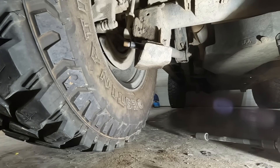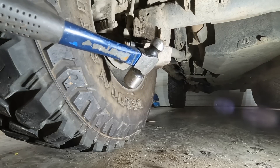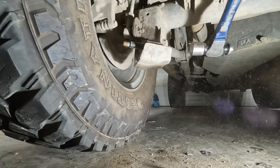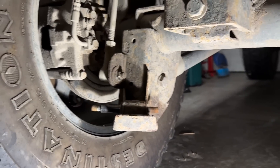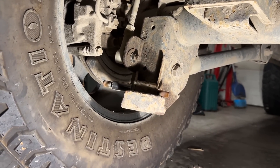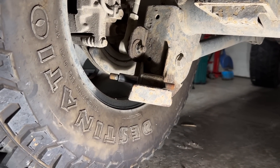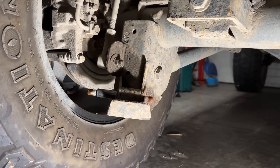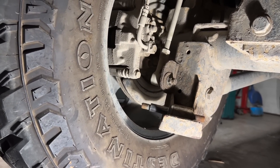I'll put a nut on the end of that and see if I can knock it free, but it's so seized up. This is a perfect reason why you always use anti-seize, because if I wasn't cutting all this out to put a whole new bracket on, this would be so much more work — that bushing and everything is stuck in there. Let that be a lesson if you're watching this video. I also have to cut that sway bar link off too, but I already have new ones.